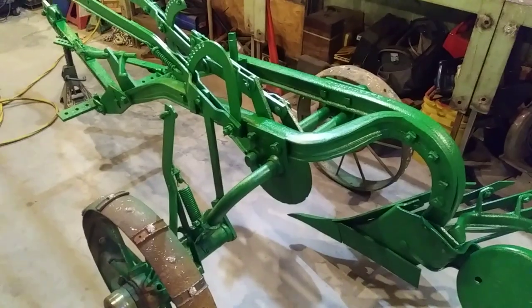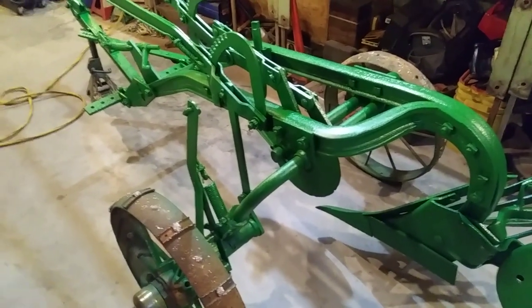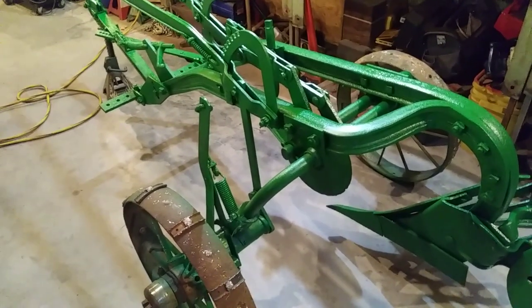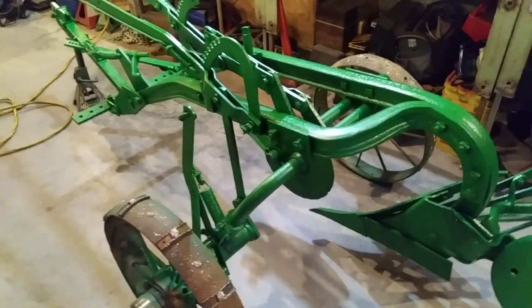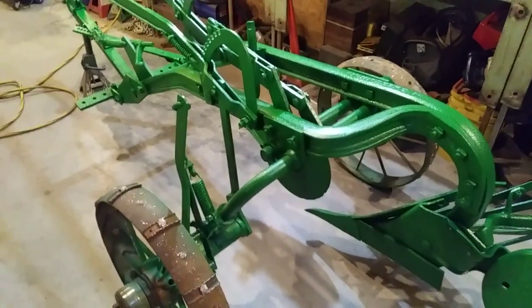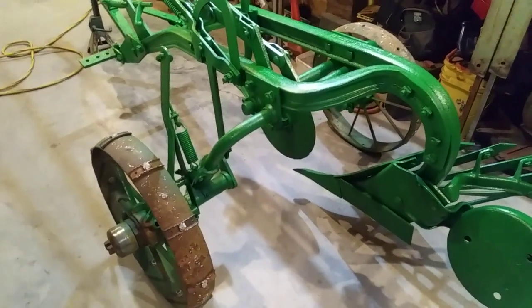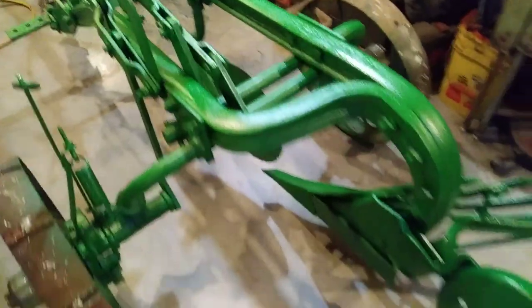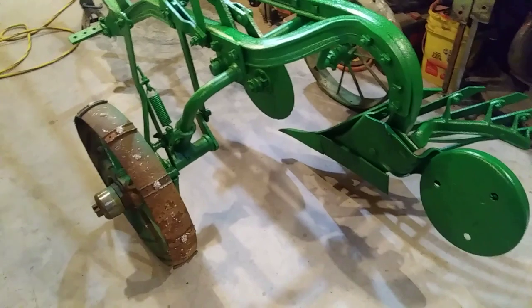The green paint is done and the yellow's not done yet. I just did the green today. We're getting toward the end of October and it's getting pretty cold during the night — down in the 30s. During the day it warmed up to the mid-50s when I started and got up to about 70 this afternoon. I sprayed it in the early afternoon — you're not supposed to spray below about 52 degrees according to the Rust-Oleum can. I backed it into the garage to make sure it doesn't cure funny overnight when it gets cold again.